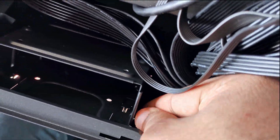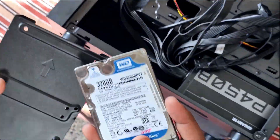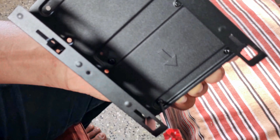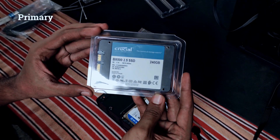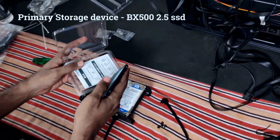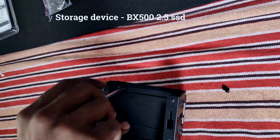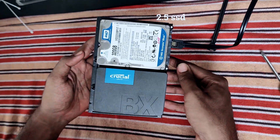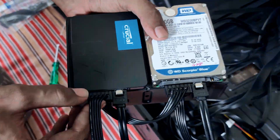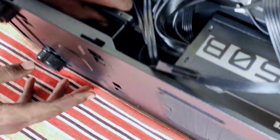Now let's go ahead and install the drives. For that, you have to remove this drive bay. You can install two 2.5-inch drives and one 3.5-inch drive. We are installing this 320GB hard disk taken from my old laptop, as we are building a budget system. Here is the SSD we will use for primary storage — for Windows and all. This is the Crucial BX500 2.5-inch SSD. I would suggest going with the MX500 as it has DRAM and is faster, but this is a very cheap option. This SSD comes with 240GB of storage and the hard disk has 320GB, making about 560GB total, which is limited but we can upgrade in the future with a 1TB or 2TB hard disk.